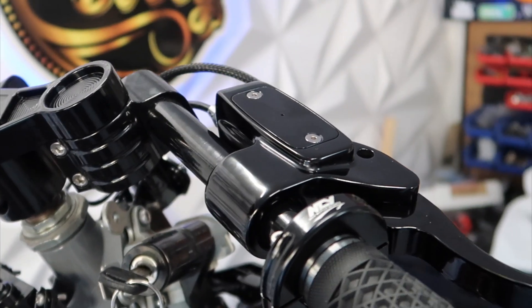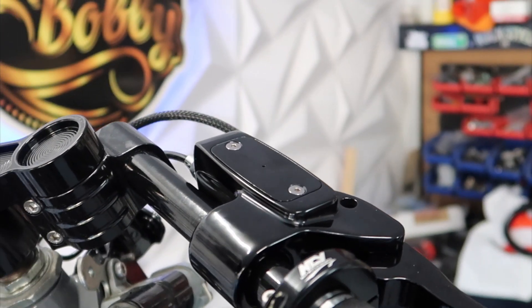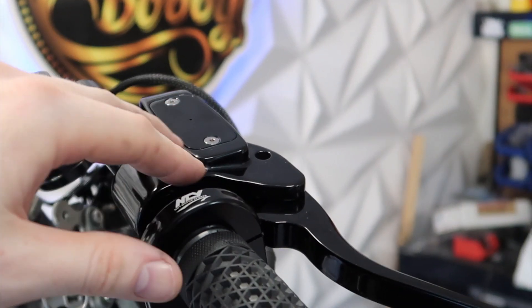If you order the NCY or Adelin forks and you're happy with how the height is, don't even worry about this. If you want to lower it like I do, I need to take it down about another inch. All you need is a 17mm - at least for the Adelin forks - and something to cut the spring with, like a cutoff wheel. First I need to show you this brake setup. This is my HHI master cylinder - it's made for Harleys and a lot of bagger bikes. I like it because it's super clean and the powder matches the powder on the handlebars.